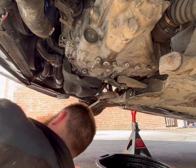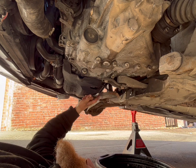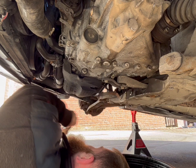And it's me again overlaying the audio. You're joining me underneath the car. We have a 19mm hex bolt for the sump plug, which you just use a breaker bar, knock that off, and then wind the sump plug out. Now to catch the oil.